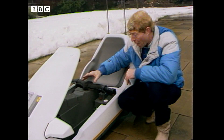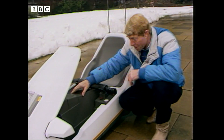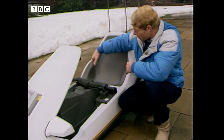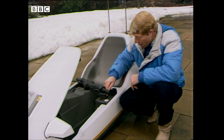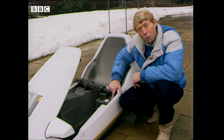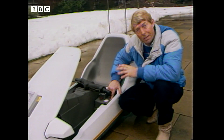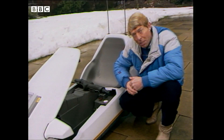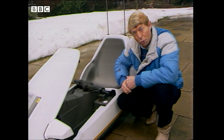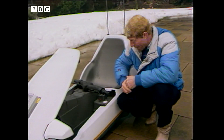It's got a steel chassis, and because of that the brochure compares it to the coach-built cars of the past. Y-shaped, it bears the single front wheel and the two rear wheels. The battery is obviously a very important element. Like a normal 12-volt battery, it's a simple lead acid — in fact, a deep discharge unit, which means you can run it flat and recharge it again three or four hundred times in its lifetime, which of course you can't do with a standard battery. It takes eight hours to recharge from flat.